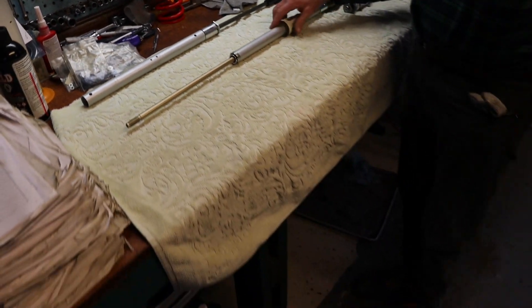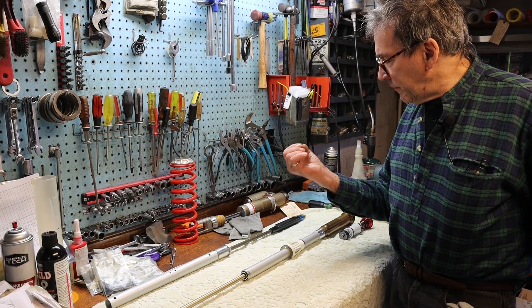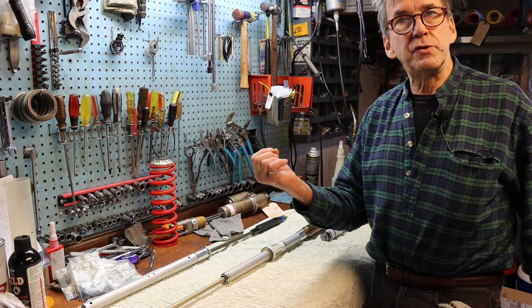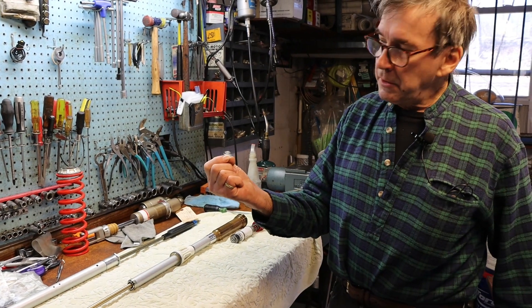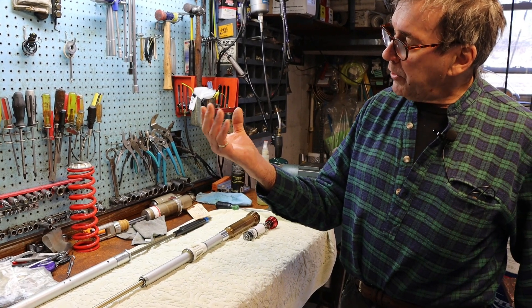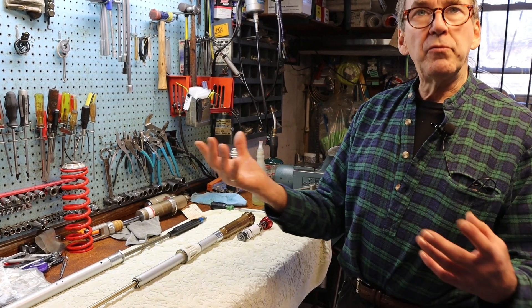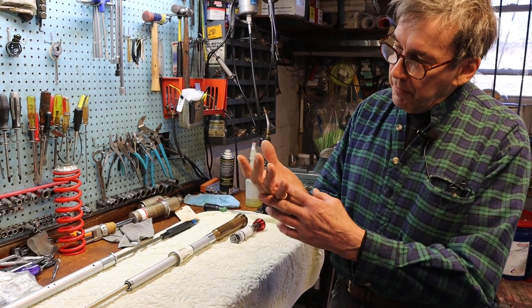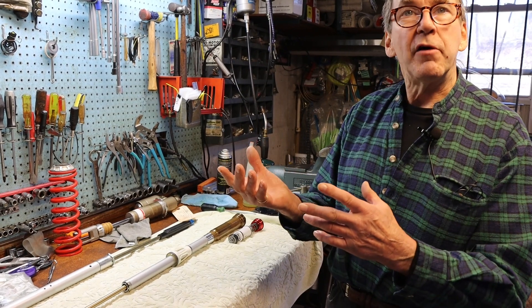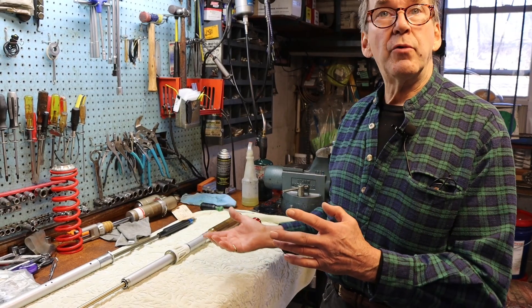What's going on is we have polymers in the oil that keep the oil consistent in its viscosity. The polymer works like a spider — as it heats up, those little spider webs extend and make the molecule larger. After a while, the little hairs on the polymer start to get sheared off — that's called shearing — and the efficiency of the oil will reduce.